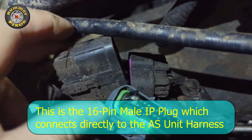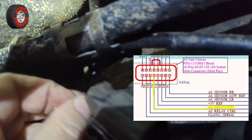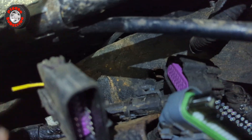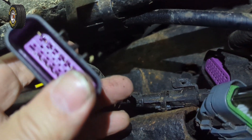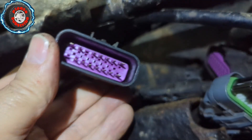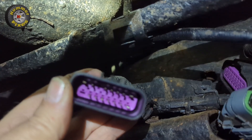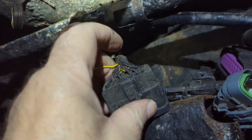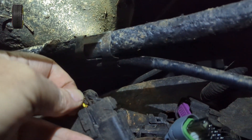I had a tug on the corresponding wire and this wire just came out. I can confirm that is the ground wire that takes the air suspension relay ground to the current monitoring ground inside the electronic module - so that wire is the root cause. We've just lost all connectivity and that's the problem. We need to repair that cable somehow, though it's a bit tricky. I do have a spare harness, so we need to re-terminate that pin - it's the fourth place along from the end, and you can see where it's come out. The wire has fractured off over time.